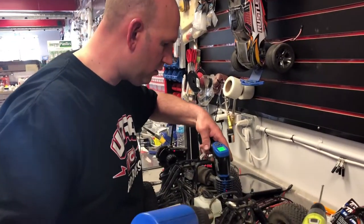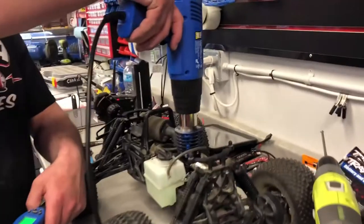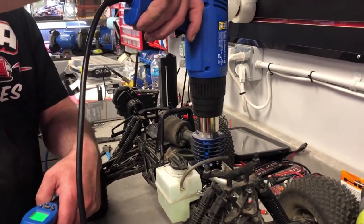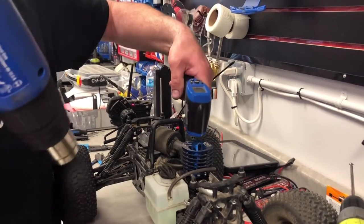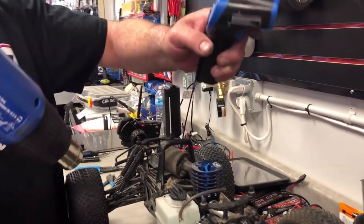With that, you're gonna be opening up the sleeve inside of there and not being as hard on pistons, because it is a taper fit. So we just want everything to be a little bit looser for initial startup. Now that we've primed it, we have fuel in the engine with the lubrication, since that's all built in. So I just like to get it to 200 degrees and we're good to go. Then you should be good to start.